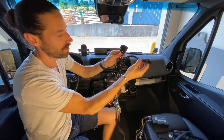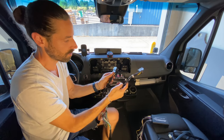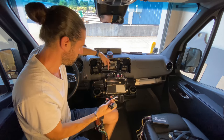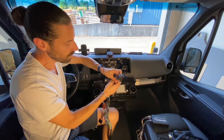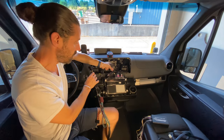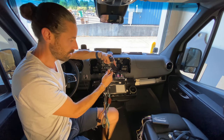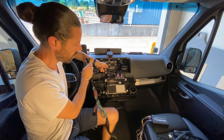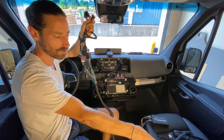The final connection for your harnesses is straightforward. This harness looks just like the factory harness. You take the factory harness out of your stereo and plug this one into it. Then you have the factory harness hanging there and you plug that into this one — so your factory harness goes in here, this replaces the factory harness, and then everything goes out to the amp, and the amp goes out to the subwoofer.